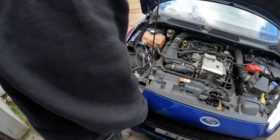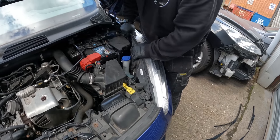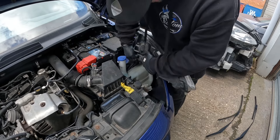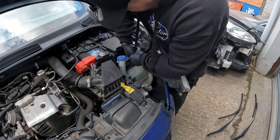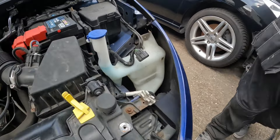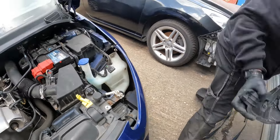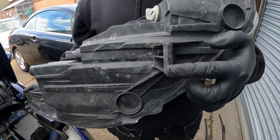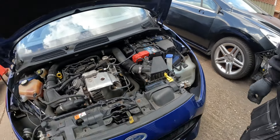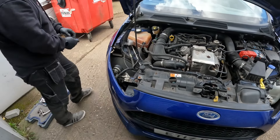That's all still fine. That noise when removing the headlight - it's not anything breaking. There's a little prong on the headlight that just sits down into a white receptacle there, and obviously as you snatch it out, the clip snaps forward. It just sounds like you're breaking it - and it always feels like you are as well. Right, let's retrieve these clips then.